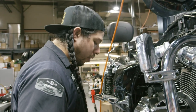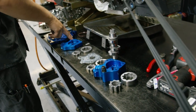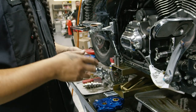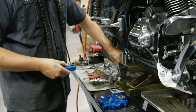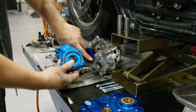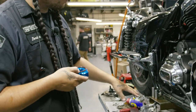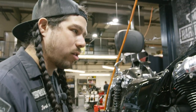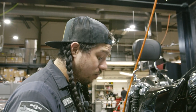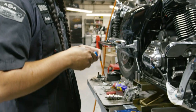This is what we're going to go together with: S&S plate pump, Moonshine 45 cam. We've got new seals here. The seal is very important — his old one did not have one. This is going to help with the sumping issue. Would not recommend going back with that. You can use a stock plate and pump, but you've got to use the latest rendition — it has a seal on the back. That's what you want if you're running OEM plate and pump. The new ones, there's nothing wrong with them, they're really good.